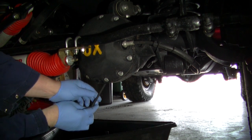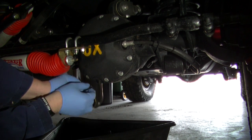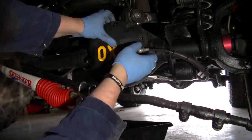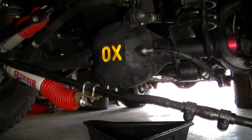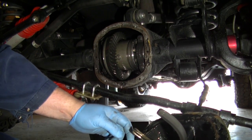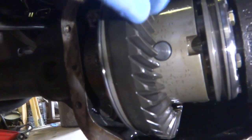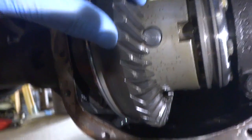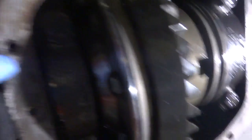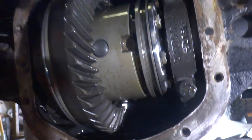What's nice about these is that we got a drain. We got her out. Just examining the gears — I don't really have a drive pattern on yet because there's been no four-wheel drive driving around during break-in. The coast pattern looks good. I examined the lock on the bolts here, they're still good on the back side. All those nuts are still in place, no chips on the gears or anything, so everything's looking good. We're going to put the new gasket in and put her back together.